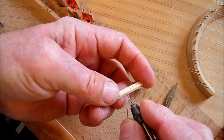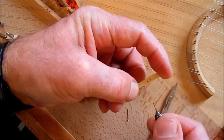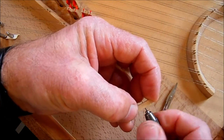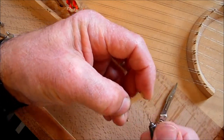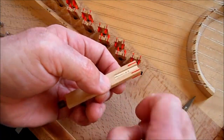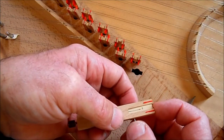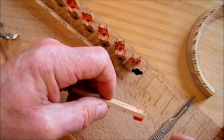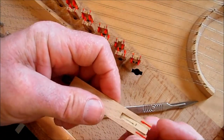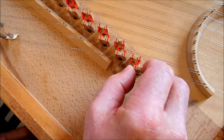What I'm going to do is work the hole in the tongue just slightly bigger with the use of this pin set, with a slightly oversized pin in it. So I can then pop the jack back together again, lining this up gently as I do it. That went in very easily — sometimes it doesn't. Push the pins and it's a tight fit and doesn't come out. Now hopefully that's solved that little problem.